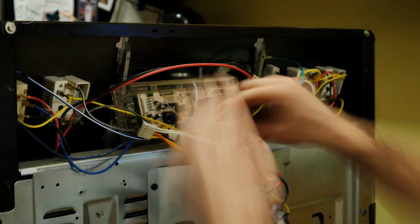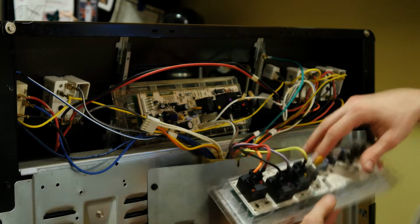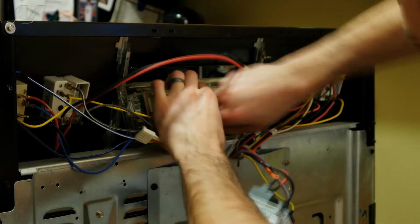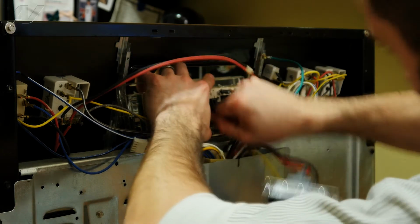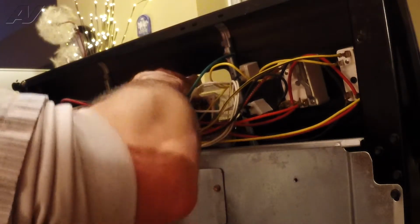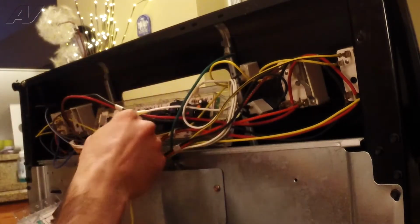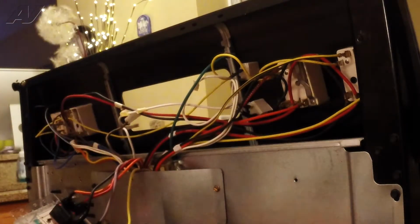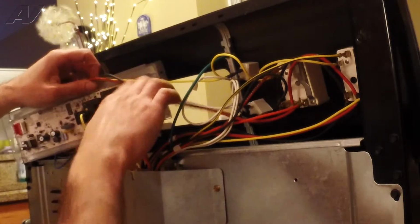And it looks like you've got a wire for your light. So you make sure both of these, the board is marked for the neutral there. So your white, take it to neutral. The brown, you take it to the other pin. At this point, we can go ahead and get this board out of the way. Bring our new board up into place.